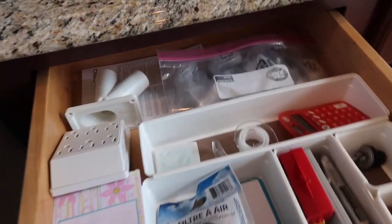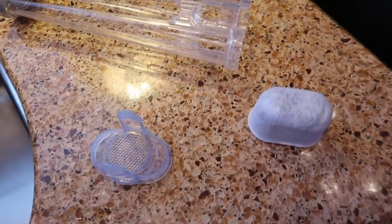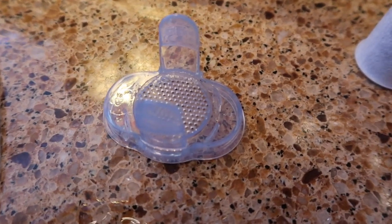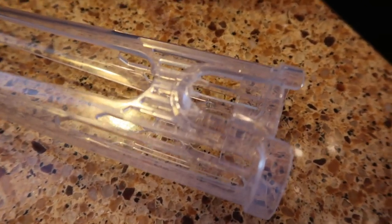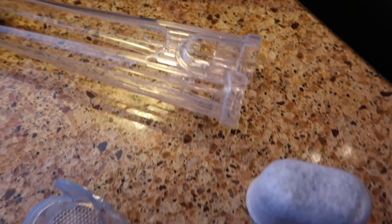I keep the filters back here in this bag — those are the coffee filter individual bags, and I put them in a Ziploc bag. To remove the filter compartment, you press the little buttons on the side — put your thumb and pointing finger on each side, press in and pull down at the same time. It has the word 'press' and 'pull down' written on it. There's the used filter and here's the new one. I'm almost positive it says to let the new filter soak in water before inserting it, so I'll let it soak and throw the old one away.